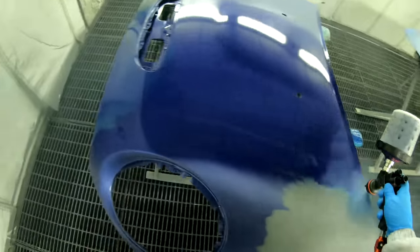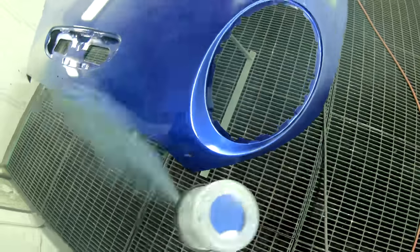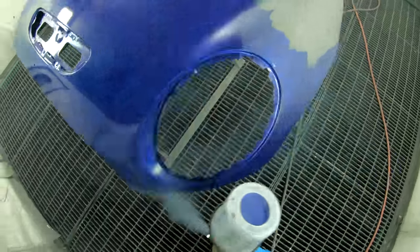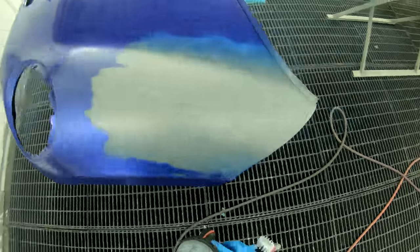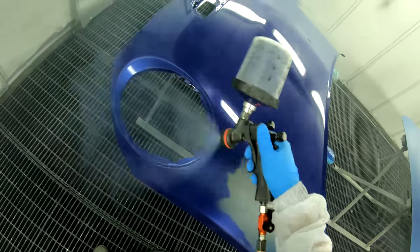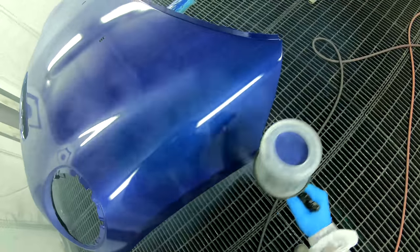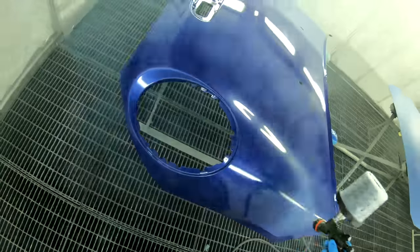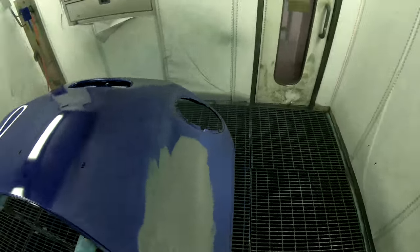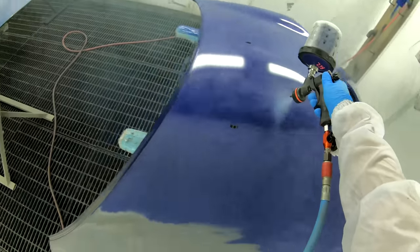I've already cleaned it off. Panel wiping is probably the longest part of the job — making sure it's absolutely clean. Solvent wipe, got it cleaned up, make sure all the solvents and degreasers completely evaporate from the panel. Then I come back in and hit it with the water-based degreaser to take off any water solubles or water-based contaminants. I like to keep everything super consistent.